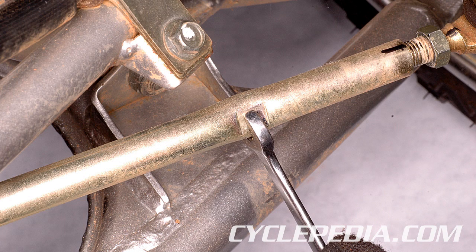Turn the tie rods with a wrench at the flats to change the toe-in. Be sure to evenly adjust the left and the right tie rods for proper alignment. Check with the service manual to see if there's any specifications for the length of the tie rods or the amount of threads that should be showing. If the tie rods are not adjusted according to the OEM specifications, the proper toe-in may be achieved, but the vehicle will not steer correctly and it could risk breaking a tie rod.